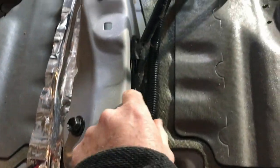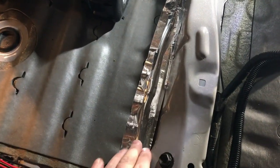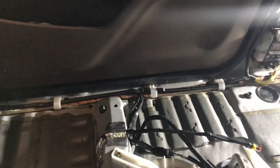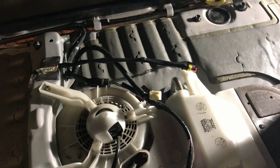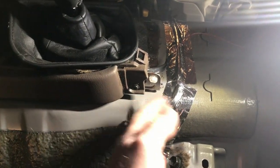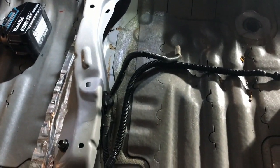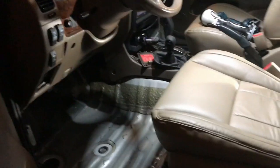One of them right here goes up to the driver's seat. It's the same length. So there's the 2 plugs for the driver's seat, the stock one right here, and then the one for the heater. I did decide to route it, I just hate routing stuff up underneath the dash, so underneath the tape you can see it runs all the way over, right in front of the seats, and then over to the same kind of stock location. There's the other one right there where the other stock seat is by the rear heater deal. It should be fine. It's not a lot of wear across this section, and there are no critical clearance issues. So I just used some aluminum tape. It's nice and sticky. It'll hold it down and won't vibrate. So that's that, and all that's left is to put the seats in and test them.